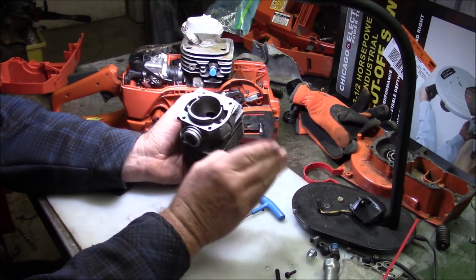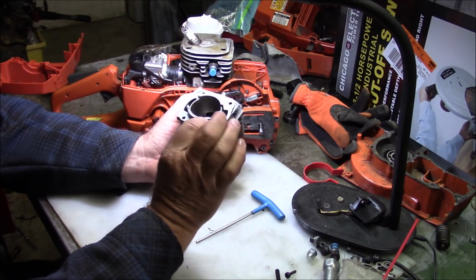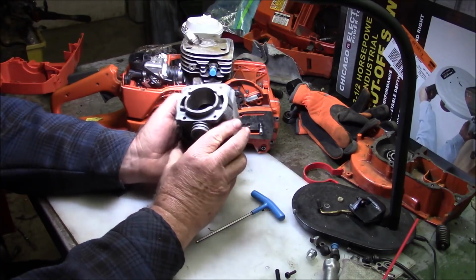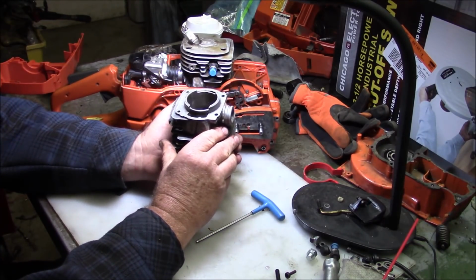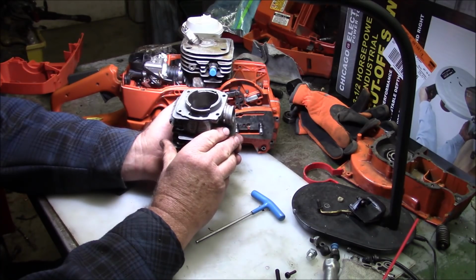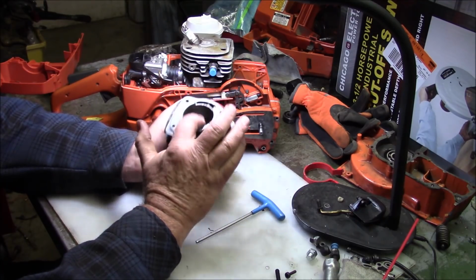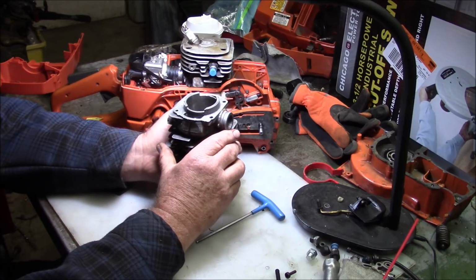Actually, if you go by theory, you want, for higher RPMs, a higher blowdown number, not a lower. So when people start arguing about theory, go read the books. And when you start seeing these saws that run at high RPMs with a low blowdown number, the first thing that tells you is they have a decked cylinder and that piston head protruded into the cross-sectional area of the transfers, and they had to get those blowdown numbers that small in order to get the cross-sectional area back.